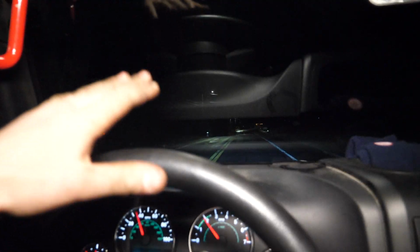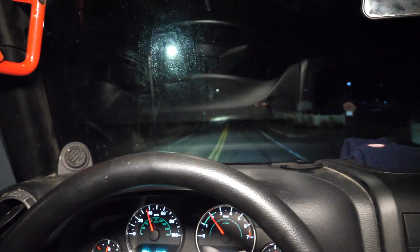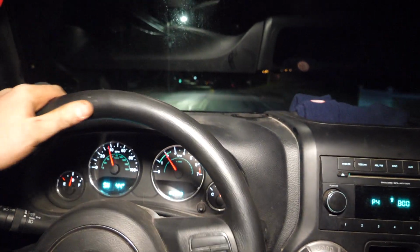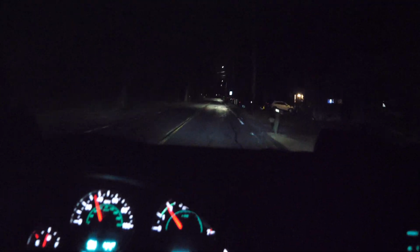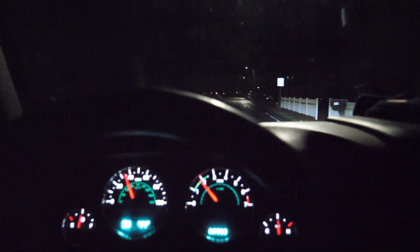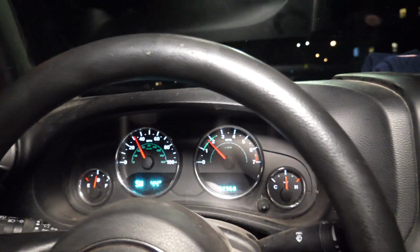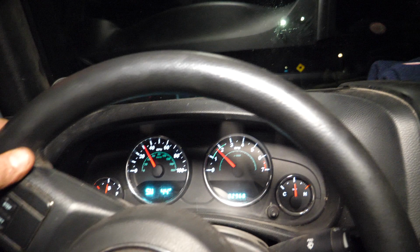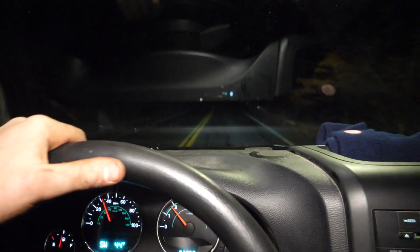Alrighty folks, pardon the light bar wind noise here, but after doing some pulleys and brakes, we're back on the road here along with our new drag link and tie rod end, and I am super pleased to say the steering is nice and tight now. I'll show you guys. Very responsive. Probably hard to see with the light on, so I'll show you a little bit better here. But I cannot shake the wheel back and forth like before, or else this thing will tip like crazy. I can move the wheel maybe an inch. I have an inch of play, opposed to about 6 inches of play originally, so this is a huge improvement over before.